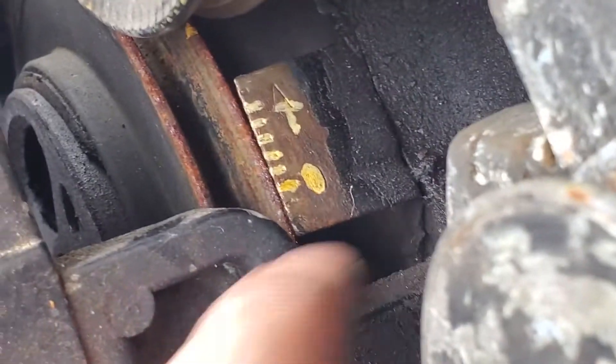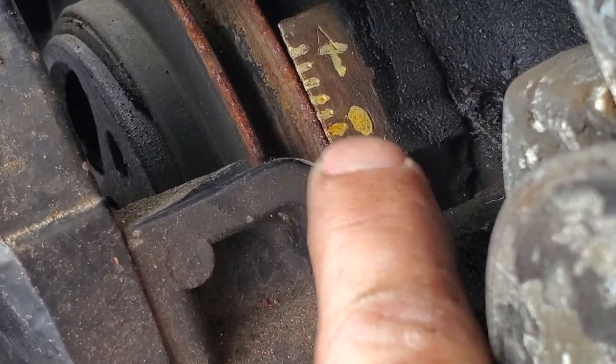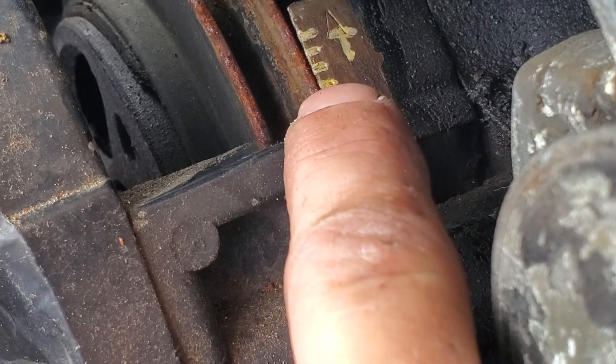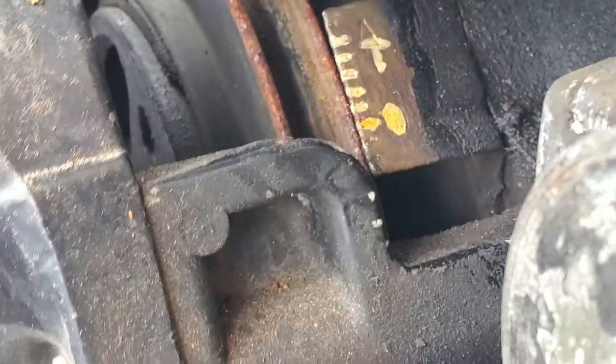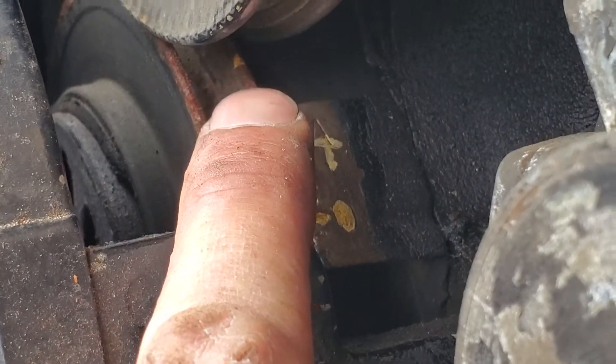This one's so worn I had to put a big zero where the zero was. These are degrees before top dead center — so it's two, four, six, eight, and ten. That allows you to know where your firing is going to be. You can see the little dot over there that's continually spinning in circles.